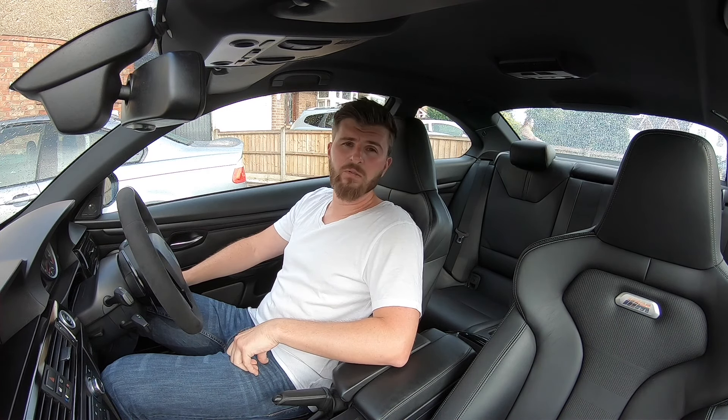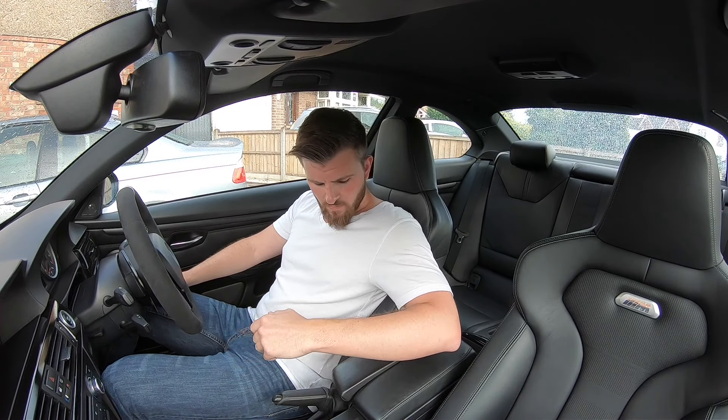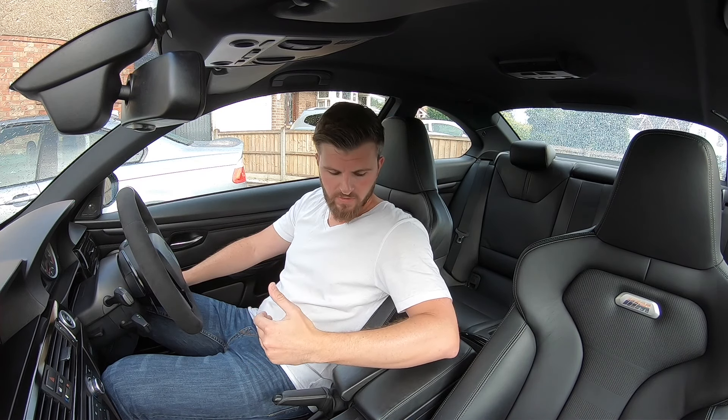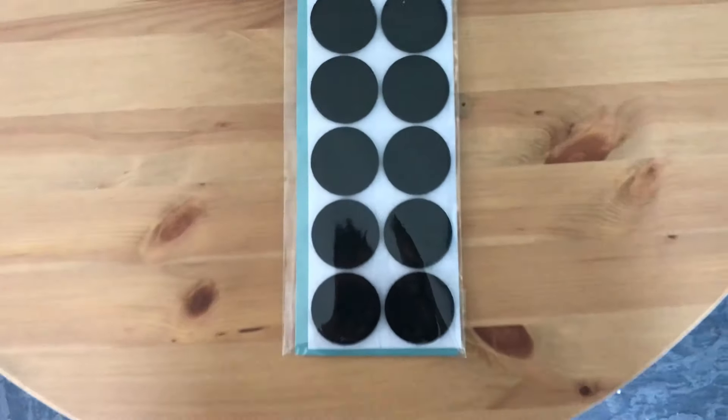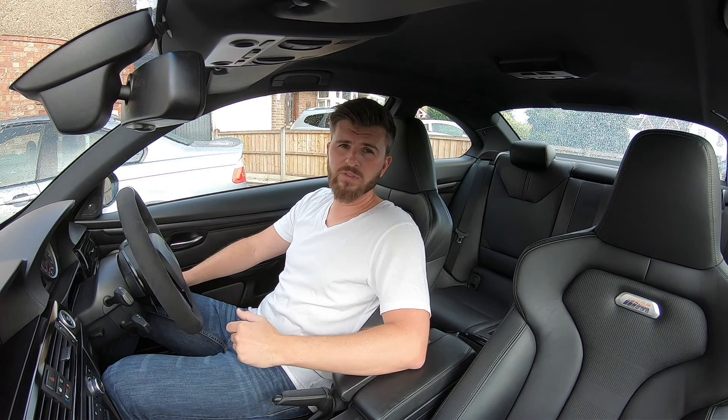This conversion is pretty foolproof — the only wire you need to cut is into the rear footwell puddle lighting, just a snip to tee off for the rear badge lighting. If you don't want that feature, don't worry about it. Regarding the squeak: because of how close the seats are to the centre armrest, going over bumps causes a squeak which can be annoying. I bought some felt pads that double-side onto the centre console — absolutely no squeaking at all now. The seat still goes forward and backwards, so it's no permanent modification.